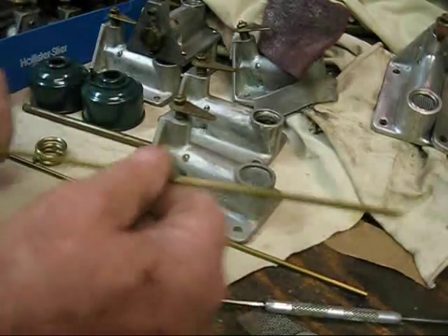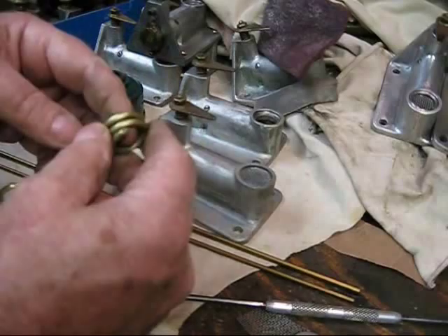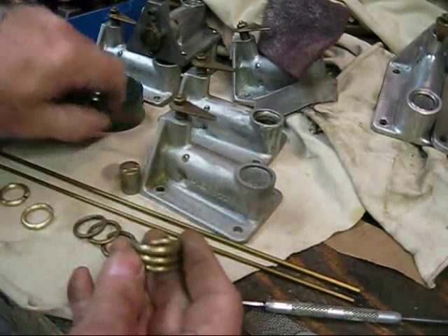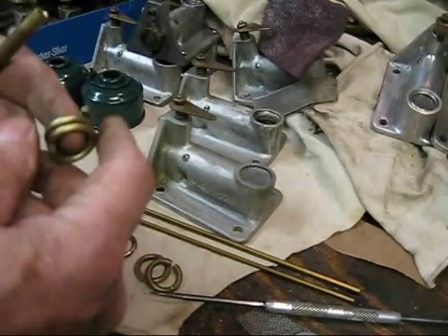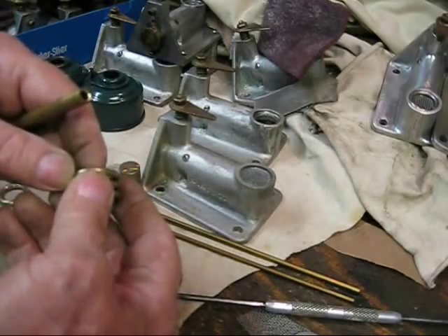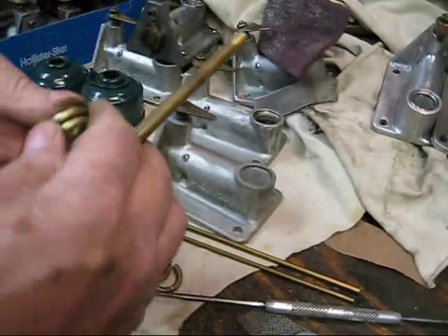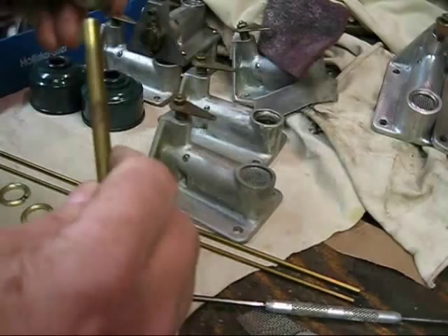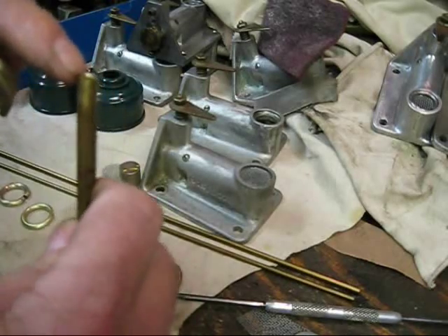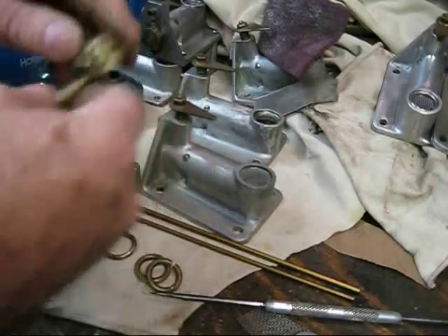You just put the screen and snap ring right there, hit it with a hammer and it will go in and be as original to some engines. I have 1/8-inch stock and 5/32nds. I turned this spiral on a mandrel in the vise using a round rod. I heated and annealed it to soften it, and then when you spiral it, it will work-harden. When you put it in, it will have enough spring to hold. To facilitate that, I took thick-wall tubing near the size of my stock and beveled the edge so it would not scratch or dent the material, then worked it around the mandrel.